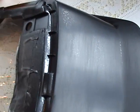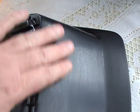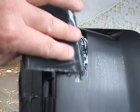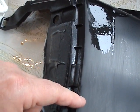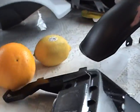Get yourself a dry rag, put some water on this, wipe it off and look at it. If you see some bad areas, go back and go over the bad areas little by little, just a little bit. Remember the golden rule of painters, the number one rule: stay off these edges. Now explain why. This is where a lot of beginning painters have really messed up.